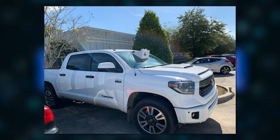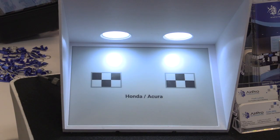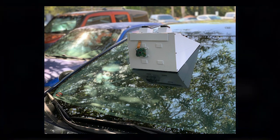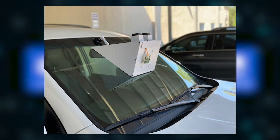We came up with this approach where we've miniaturized the target. We've scaled it down — it is to scale. We calculate where it would be placed in front of the vehicle and reduce it according to that distance, where it's now this far in front of the camera instead of 3,000 millimeters in front of the camera. We're scaling it down, dealing with the aspect ratio and the perspective, making sure it's at the appropriate height in perspective to the camera, and display that image.